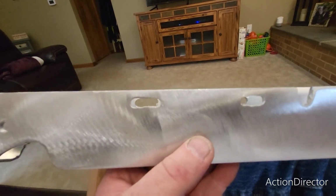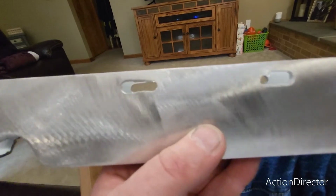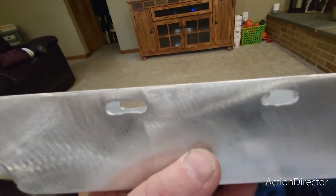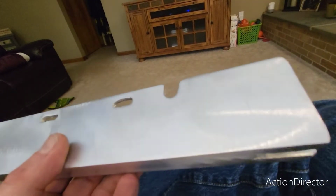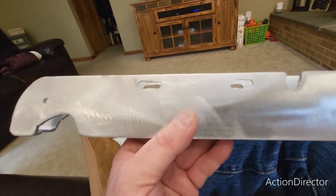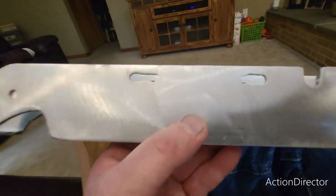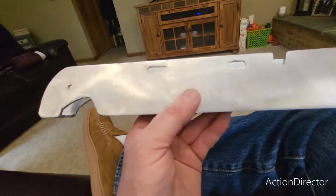Now, when I clamp this on, I may use maybe some rubber or something to protect between clamp and the body of the trolling motor, because anytime you put one metal to another metal, they react different, and they could cause premature corrosion that I don't have and corrosion I don't want. So you can't really overprotect when you're just trying to keep things lasting long and working well.